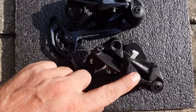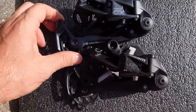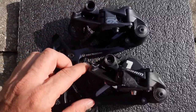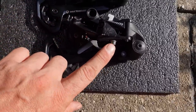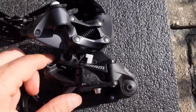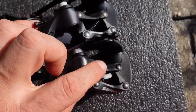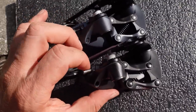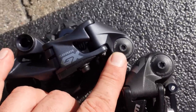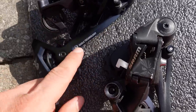This whole front end of the derailleur seems to be constructed exactly the same — obviously with the new color and branding. The knuckle is the same; hopefully it doesn't have as much play as before. The pinch bolt and the adjustment screws are now black, and otherwise all the moving arms are the same size — everything is the same. The same Type 3 clutch is used on both derailleurs.